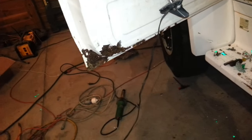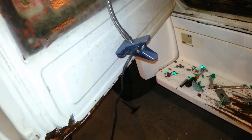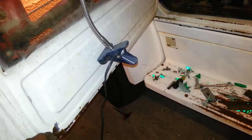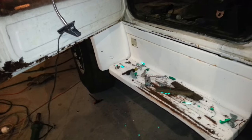I'm going to kill the rust on both sides, soak it, and when the rust turns black I'm going to spray some etch primer on it on the inside and out so it won't come back again. Then I'm going to coat it with fiberglass — long strand fiberglass to fill all that in. I might do some backing on the inside with fiberglass resin, resin all that in, then put fiberglass on the outside to fill the rest in.